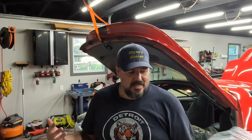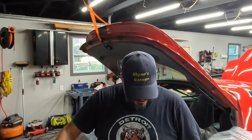If you've got tint to remove, if you've got it on your side windows or windshield or wherever where you don't have this defroster on it, you can just scrape it off with a razor blade. If you have tint on and you want to remove it, you can do it just like I did with this steam. You don't need any super harsh chemicals. I've heard guys talk about oven cleaner and gasoline. And guys, this was a lot of work, and it's hot today. Playing with steam on a hot day, I'm a sweaty mess. But physical-effort-wise, it's not that much effort. You just take your time. You've got to have some patience, and it'll peel right off.